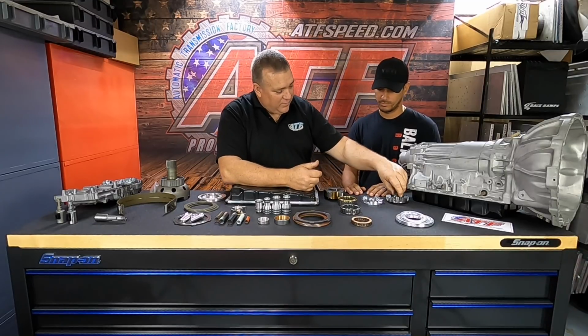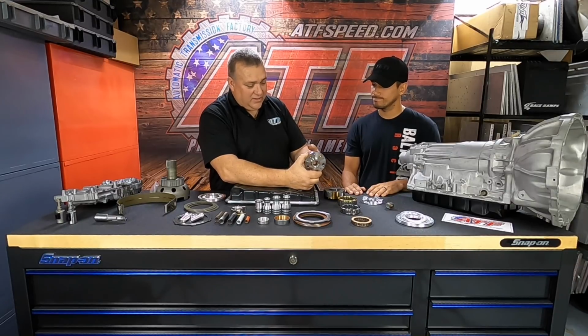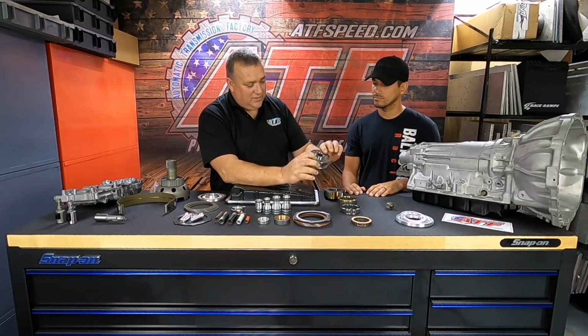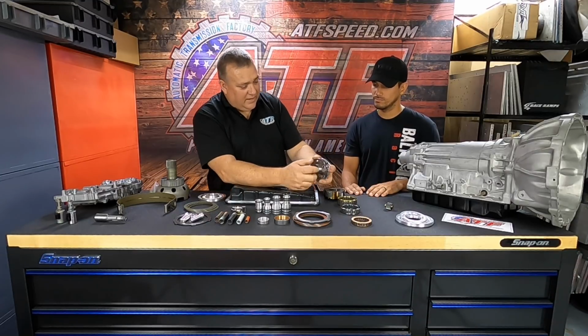So that's when we came out, obviously, with the 4140 chromoly steel. We actually heat treat the splines before we assemble them. This back piece is also out of 2024 aluminum, which is what we were trying to do, get a little bit of weight out of it, but we wanted something that we could service, so we can actually take this apart and service the thrust washers that are in there if we need to later on down the road.